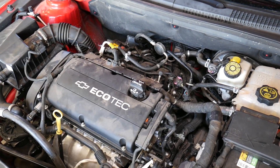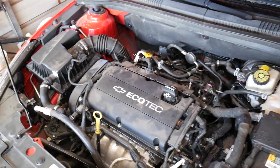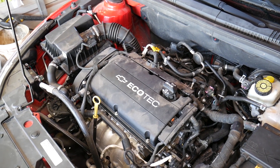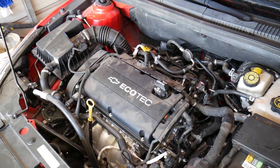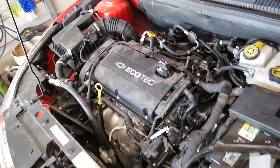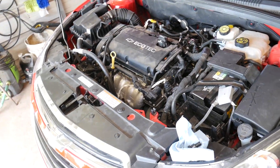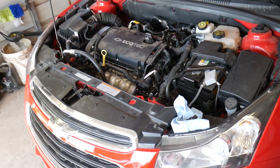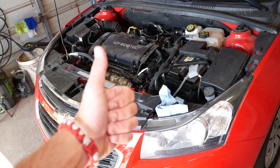It's quite complicated, and you can test whether it's stuck open or stuck closed by checking airflow, but overall on the Chevy Cruze it's not easy — you have to remove the valve cover and inspect it, and you still may not get a clear answer on whether it's good or bad. At that point I recommend just installing a new valve cover, especially if your car has over 60,000 to 80,000 miles. Hopefully this video is helpful — thank you for watching and see you next time.